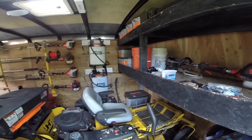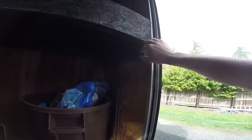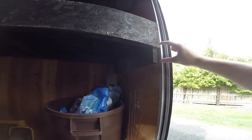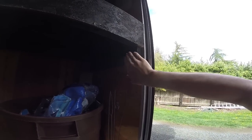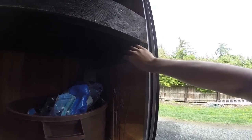Another tip I'd recommend when doing the shelving that we didn't cover in our video: on this big trailer, we've got a 2x4 right here, and then the shelf on top of that. If you're doing a big trailer and you're going to have a lot of weight on the shelf, I'd recommend mounting a 2x4 first, then doing the shelving on top of that where you have another 2x4 — because it gives extra strength. You're able to screw the first 2x4 in, then the shelf rests on top of it, so it can support a lot more than what we did on the other trailer.